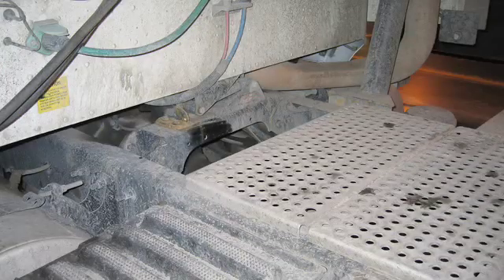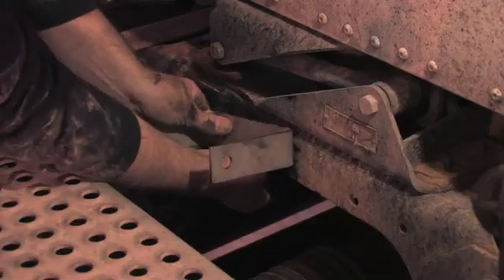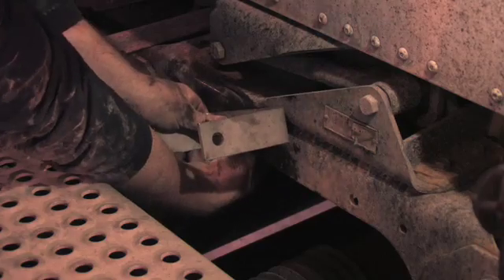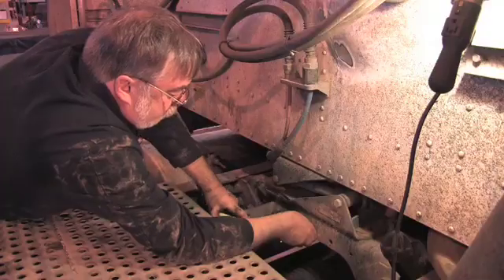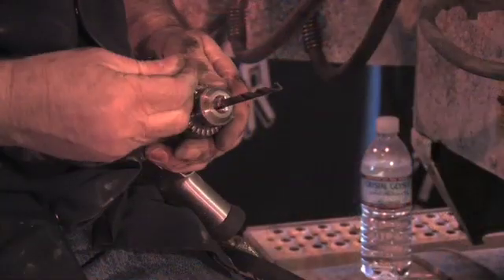Wire loom plastic wrap is used to protect the hoses. On the Cummins engine, it is necessary to mount the clean oil bowl behind the cab. Never mount the bowl to the engine block — always mount it to the frame. Since there is already a hole available, only one hole needs to be drilled. Position the bracket in place and mark the location for the hole, then drill a pilot hole and use a larger bit.